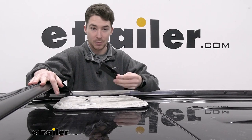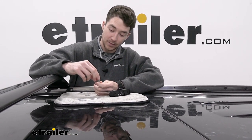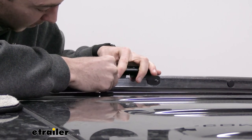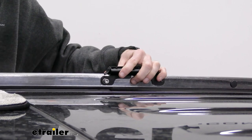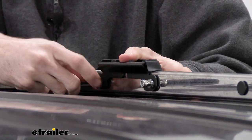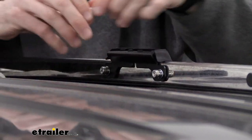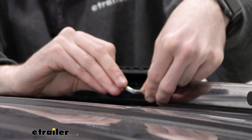Now that we have those rubber fasteners out of the way, we can get our brackets installed. We start by putting a spring washer on first and then a smaller flat washer on a cap screw, then put the bracket up facing out and hand-thread the cap screw until it starts to thread enough to stay in place. We'll repeat the process for the second screw. The cap screws are hand-threadable to a pretty good point, so we'll do as much as we can before using the provided Allen tool to finish tightening things down.